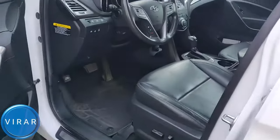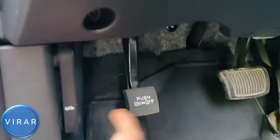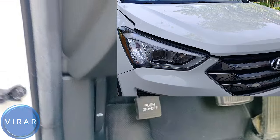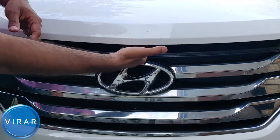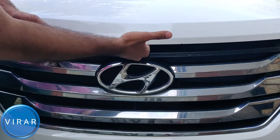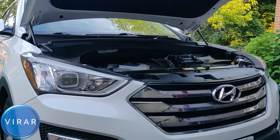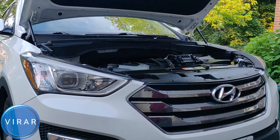Open up the driver's side door. When you open up the door, you see right where your left foot would go — that's where the primary hood release lever is, so pull it. Now in front of the vehicle, right on top of the Hyundai emblem, that's where the secondary hood release lever is. Put a couple fingers in there, press it up and then pull the hood up. The hood supports itself using those two black hood struts, so when you open it up, it stays in place.